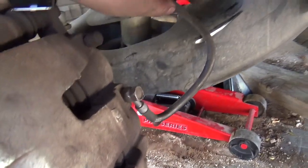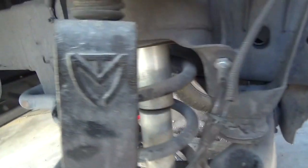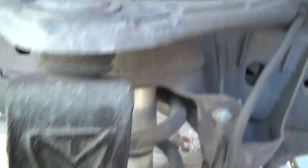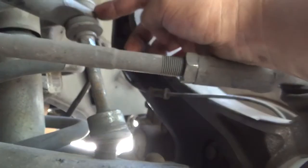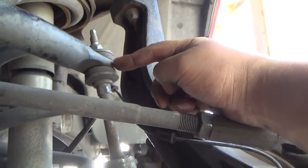That's the only concern I saw. The shock did need tightening — I did like two whole turns right there. This ball joint did not need tightening, it was good. The hub bolts — this one, this one, and this one in the middle — these three did not need tightening, they're good. Hopefully that fixes my weird problem. I'm assuming it was this sway bar that you guys saw me tighten earlier — it had a gap — so let's see what it does.